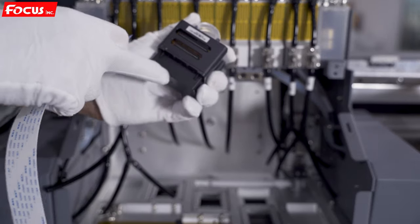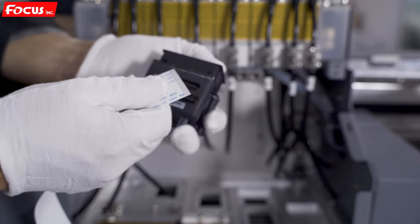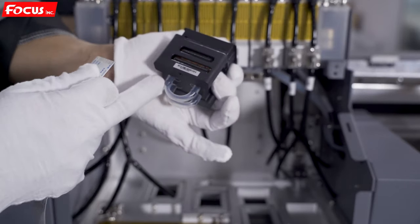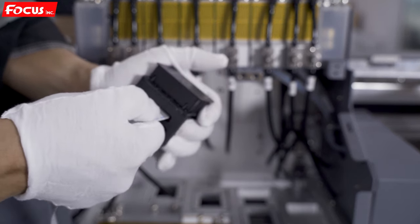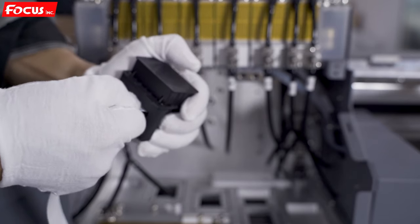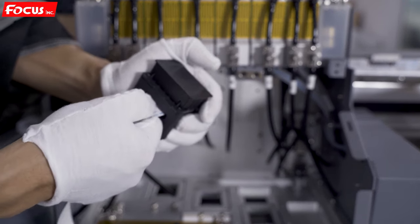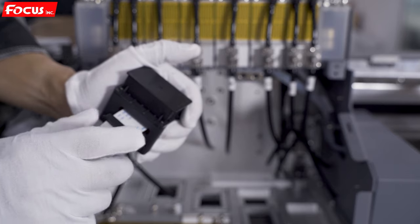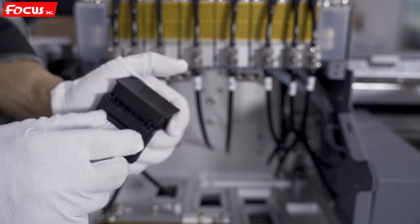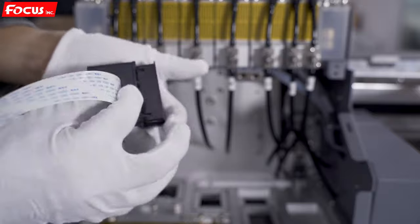This rubber is to protect against ink going through to the print head. We can see the pin is on the downside, so we must install the print head with the print surface facing up, ink toward down. We put the print head cable flat and then plug it inside. Be careful not to damage the pin — make sure the pin is not damaged before you plug in. After that, we install back the fastening ring. Then we install the bigger one.